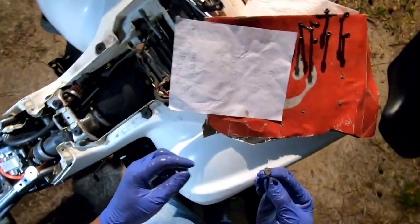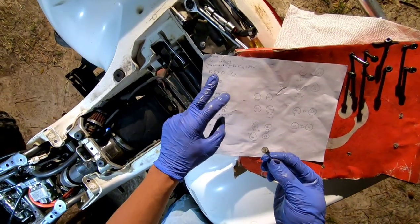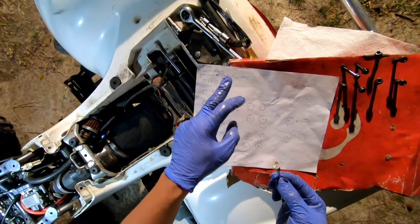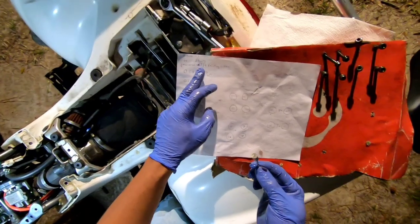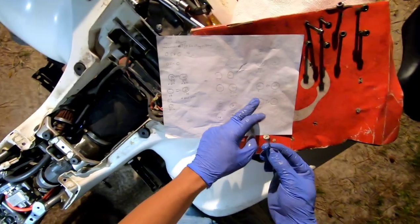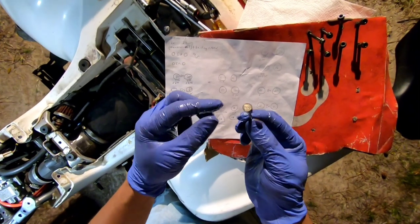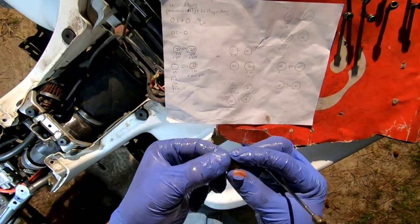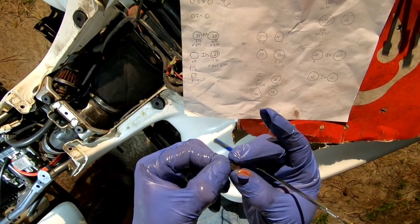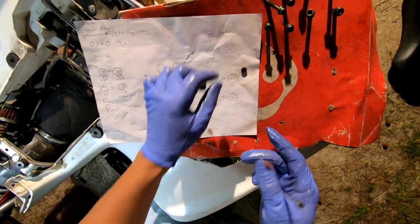And so there's a measurement to get the desired size. It's the measured size, which is 0.21, minus the desired size. So we want 15, right? I'll get the phone out and do the math in a bit. And then it says plus the existing. So this is the existing. This is what's in here. We can see the number on it. It's a 2.65. So it has a 2.65 in there.